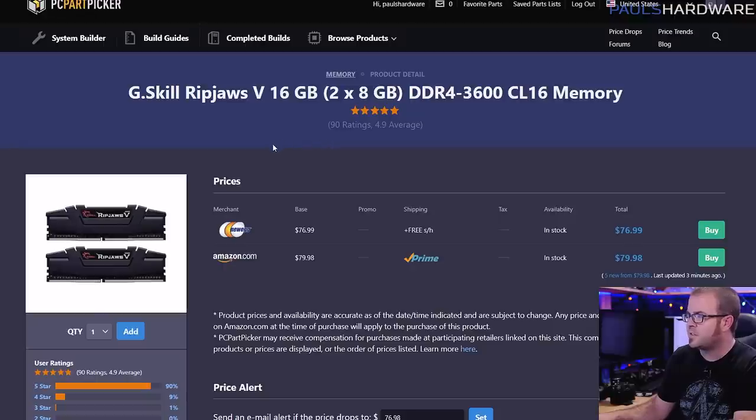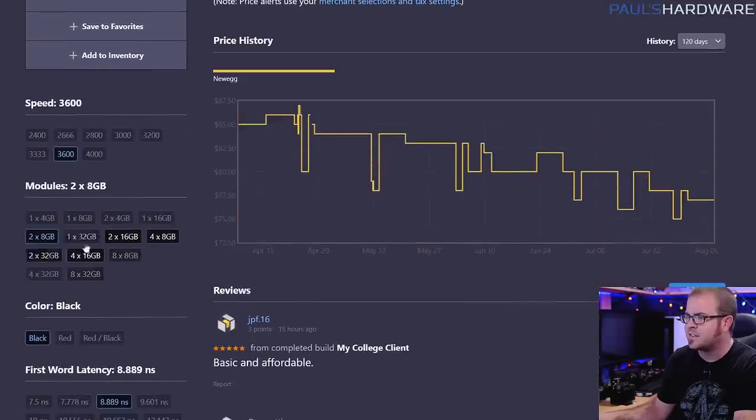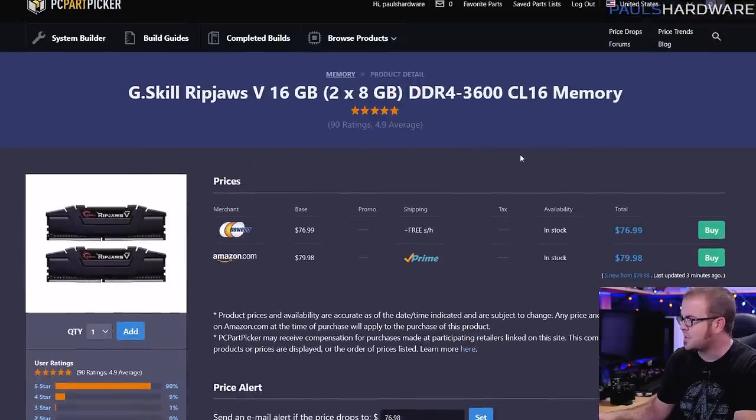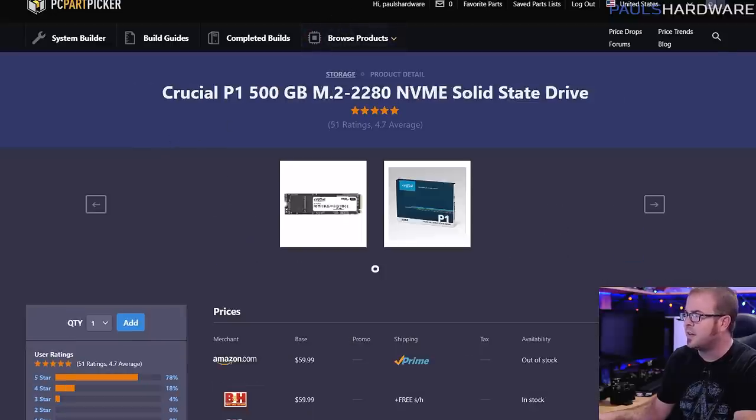Running down the rest of the parts — I'm going for functionality, not flashiness; I'm going for bang for the buck. So once again we're opting for the G.Skill Ripjaws 5 16GB kit. It's DDR4 3600, CAS Latency 16. There's a CL18 version, but I'd go with the CL16 because it's only about $10 more, and you get a 16GB kit for $77. These are plug-and-play compatible with the Ryzen 3000 series processors — plug in the XMP values and they should work.